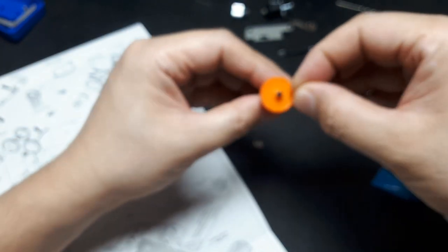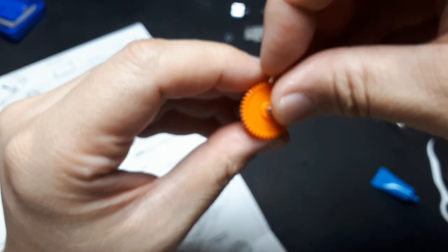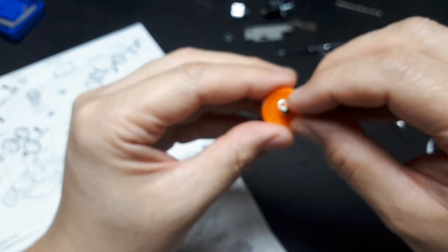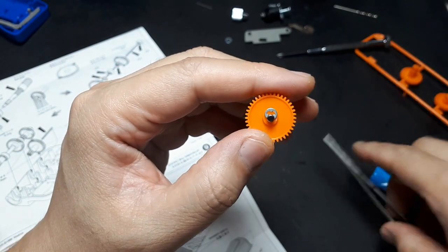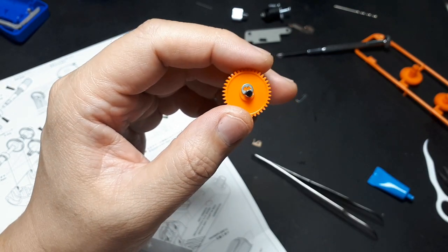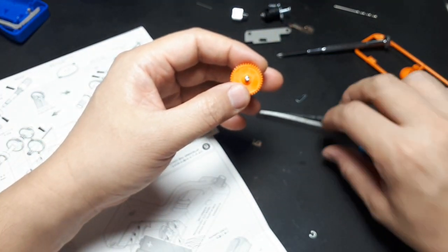And now we're going to need a circlip to keep that thing from falling off. Which I think I saw on my magnet. Yeah, there's 3 circlips, but there's only one size, it looks like. Circlips are kind of a tricky thing. You gotta squeeze them equally or they're just gonna fly off somewhere. And so I'll show you, obviously, if I can get that resting on there. Again, the tweezers might be helpful. Alright, so it started in the groove. There's a little groove there. Pliers, you want to squeeze the pliers directly in the middle of that circlip. Otherwise it's going to fly off.